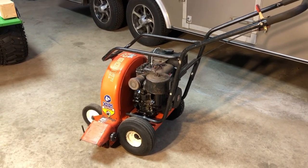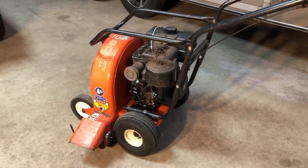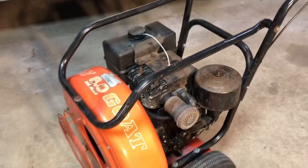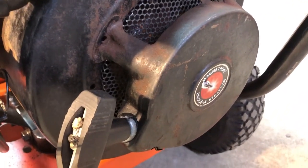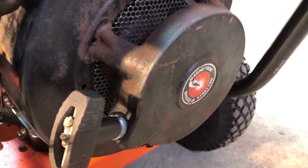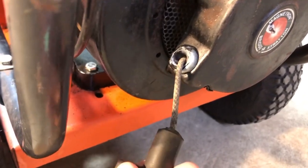My overall investment is very little money. Although the engine has a little bit of rust and corrosion on it from being in moisture before I got it, the engine was in fine shape. I took it apart a few weeks back and I'm glad I did, because there was a fair amount of debris up around the fins on the inside, which certainly would have shortened the life of it. Behind the recoil is that square shaft that works with the starter clutch assembly with the little balls in there. That half-inch shaft does require a drop of oil occasionally, especially if the engine has been exposed to moisture. So now the recoil works properly like it should.